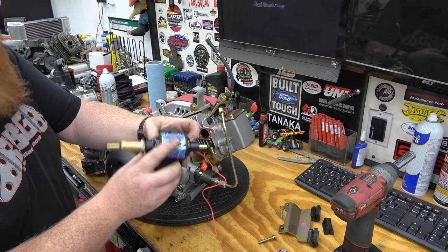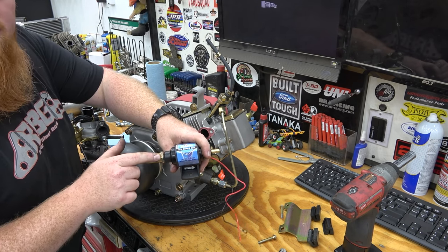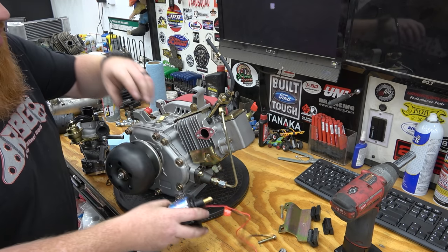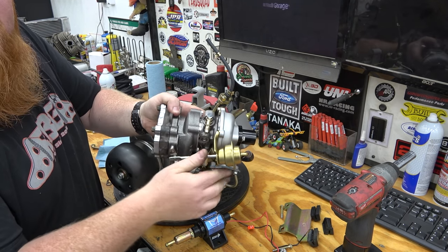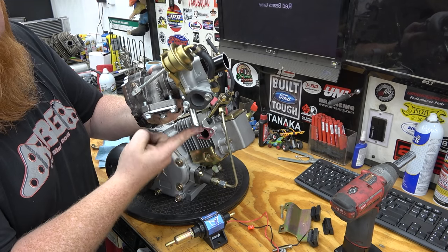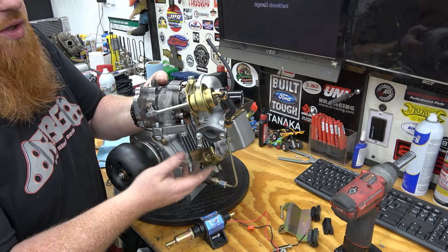So this will run from an oil tank that we're gonna mount on the chassis and come out of the oil tank into this filter, come out of here and go on the top of the turbo. And on these turbos, you always want the feed in to be coming in the top and the dump pointed straight down. And we'll just return this with a 1/2 inch bung back into an aluminum oil can.